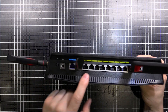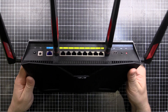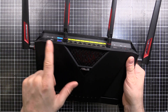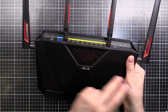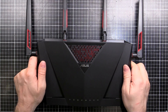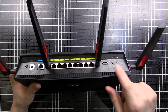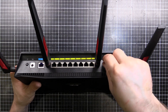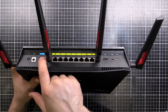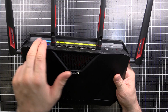It's got the usual ports on the back — eight ports, WAN input, power and USB as well. It's got four antennas like you'd usually see. There's another model with two extra antennas because it's got another 5GHz or 2.4GHz channel, giving you three channels. This one has 2.4GHz and 5GHz. The other one has an extra channel but only four ports, doing away with four of the ports for that extra Wi-Fi channel. I don't need three channels and I only use two ports link aggregated together.